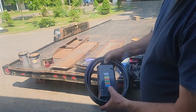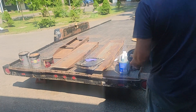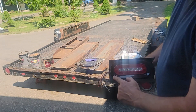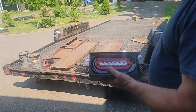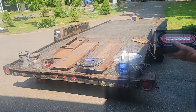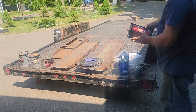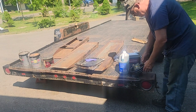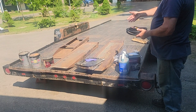This is the junction box — it has brakes, right turn, tail light, left turn, backup, battery, and ground. And this light — the center is white for backup, which I thought was amazing. When I'm pulling in here at night, I can't see what I'm doing when I'm backing up and I'm always asking for someone to help. I'm hoping that white light will shine enough that I can tell where I am. I might be able to get it wired through the truck, or else maybe do a little toggle switch so that when I get ready to park I can just flick it on.